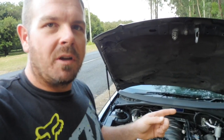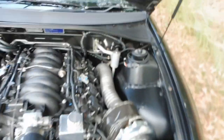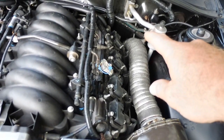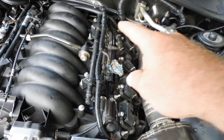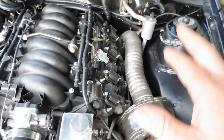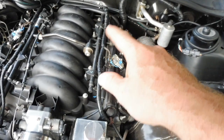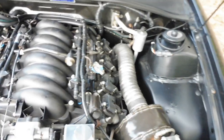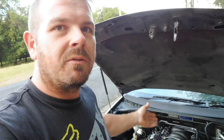And one other thing I've also noticed is, especially with my fuel setup, which I'll show you, you'll see that my fuel regulator comes out up into the fuel rail here, so there's no circulation of fuel through the fuel rail. So after you've been driving the car and it sits, that fuel that's in that fuel rail is red hot. So the first few minutes of driving, you'll find is really lean because it's trying to get through that boiling hot fuel. It'll run really lean, and that's good to remember.